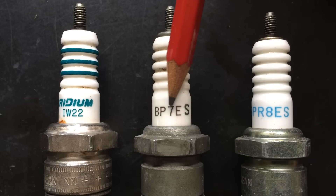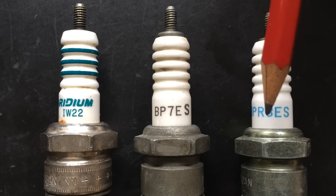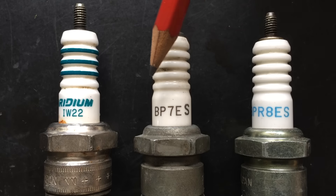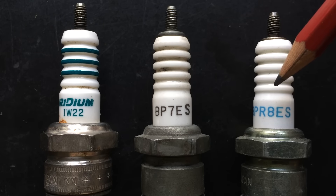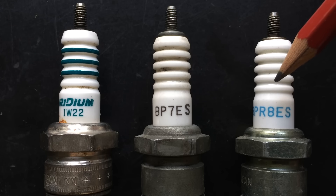Each company has their own way of marking the heat range. If we look at this middle one you can see it has the number 7. This would go in the older Marinis, and if you have a Dart you would go for a cold spark plug as the engine runs a little hotter — for NGK that has the number 8. Denso uses a two-digit number: 22 is comparable to the 7 of the NGKs, and for a Dart you would go for a 24. You might also notice that there is an R in the number — this tells you that there is a resistance built into the spark plug, mainly there for noise reduction purposes so you don't have interference to electronic equipment, radios, TVs and so on.